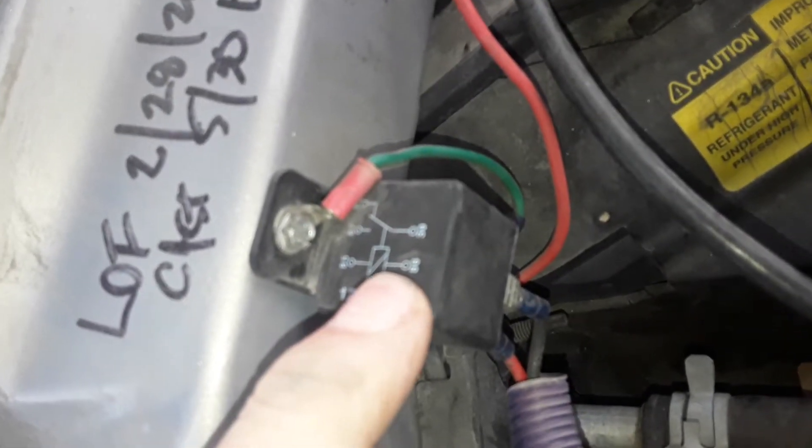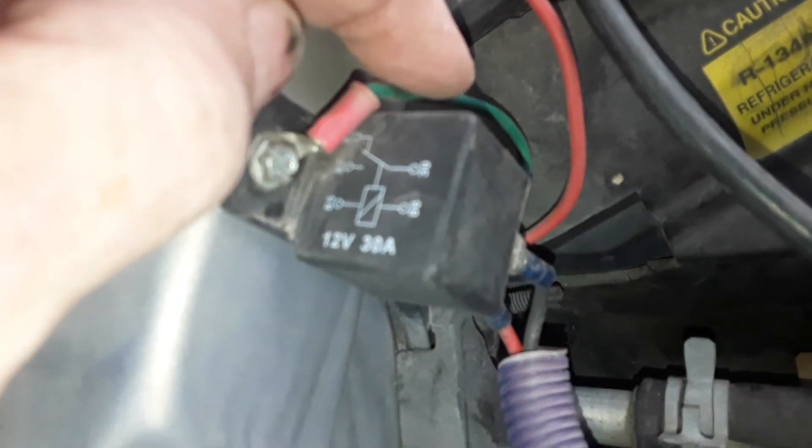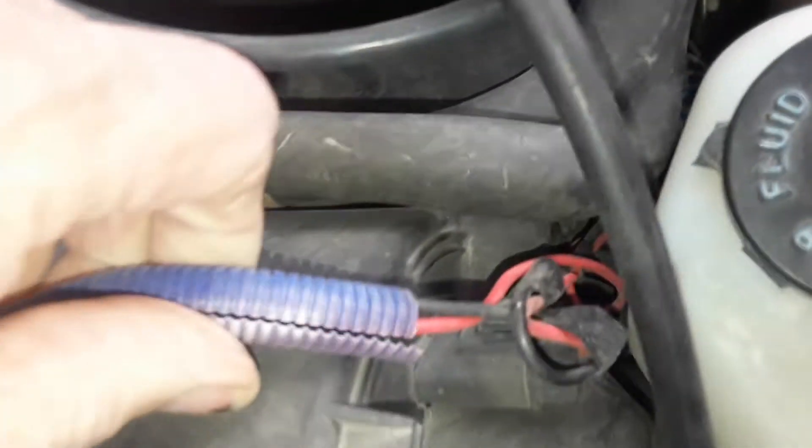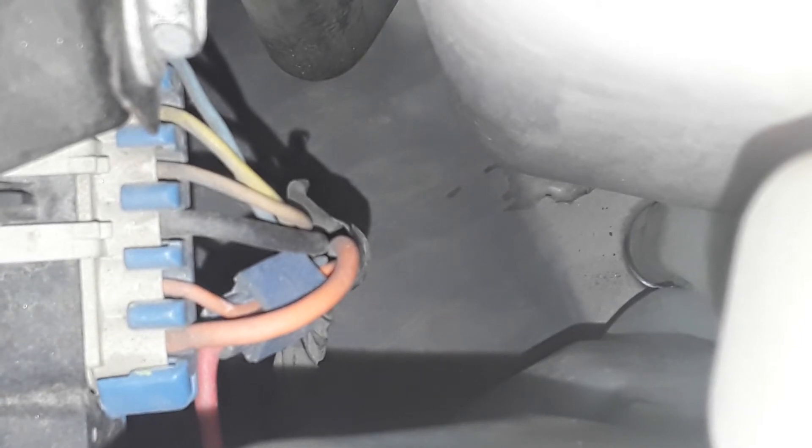The other two pins here are the command to turn this solenoid on. One is grounded — you can see the green wire up here. The other one receives a signal from the switch mount wire that comes in through this loom. You've got to check on your dashboard, or you can come out here and just start playing around with it. There's the plug that goes into the blower. You see where I put a splice on it there. The red wire is the power going from the relay to the blower motor, to turn the blower motor on high speed.